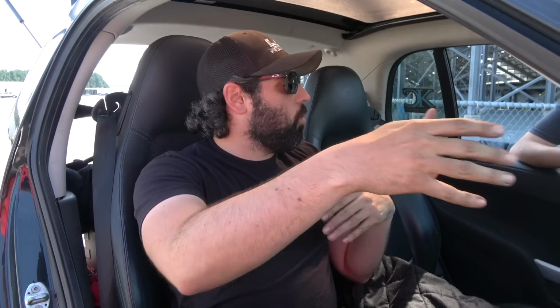Back up, clear it out. I'm a double bulb. I'm gonna grab the brake. I'm gonna go to like 100% TPS, so it gets like 3,000, 3,500. Back off the throttle, let go of the button, just drive it down and through. I guess I should have the CO2 bottle on, but I just won't have the boost controller on, so that if the shifter has to bang, it should not get high enough to bang the shifter. But I just want to drive it down there.